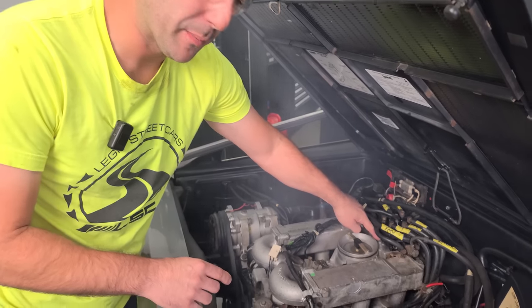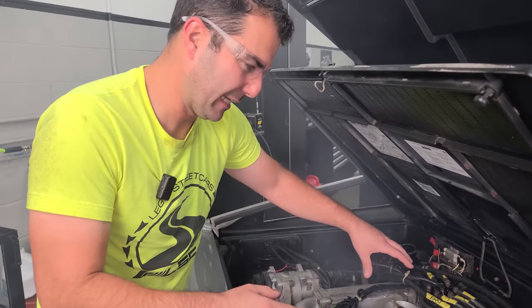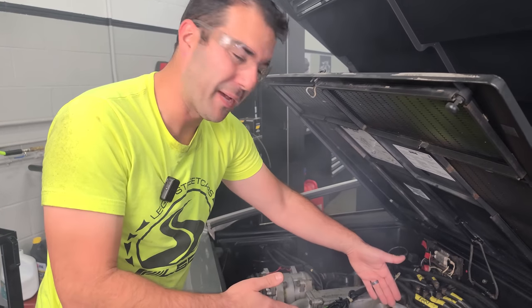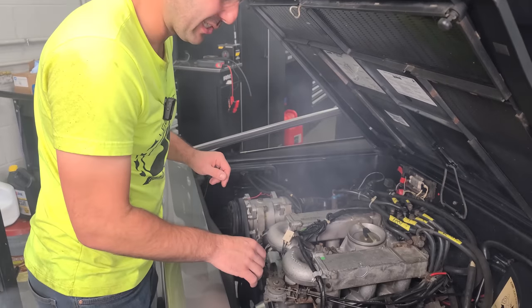There is an adjustment you can make. You have to drill something out. There's basically a hidden Allen screw that you can sync up the cam and the distributor so that the fuel is the proper amount depending on when this plate is opening. I think that needs a slight adjustment. No big deal right now. Oh, this is running good now.